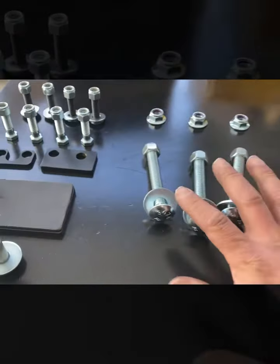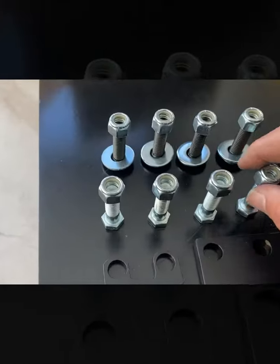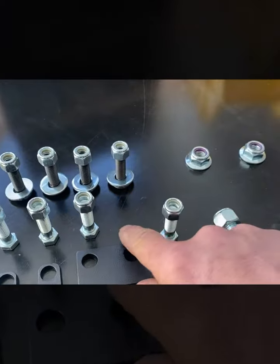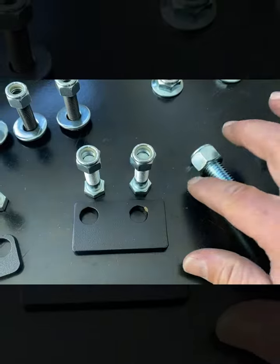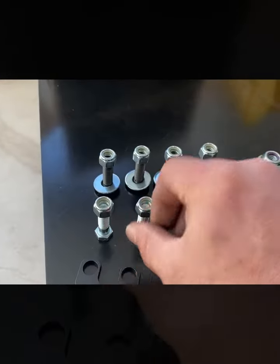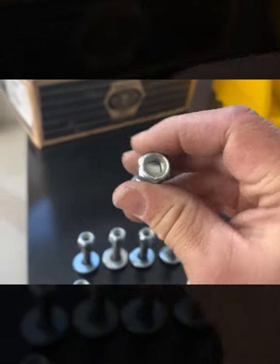If you have a 2500, we're going to go through this. You'll come with all these little parts. You'll get four of these — that's a nylock. It'll lock with these little hex nuts. Those go through these things. These two will go through those two things right here. This goes into your hinge — it goes inside your hinge. The hex nut side goes on the inside, and the nylock nut will be on the outside of your Sprinter. You'll tighten it down on your hinges.